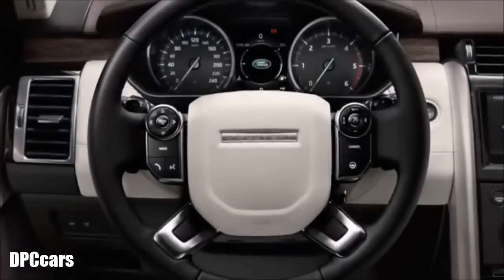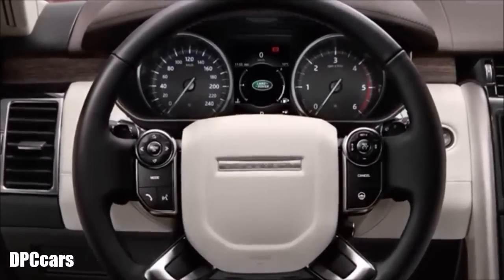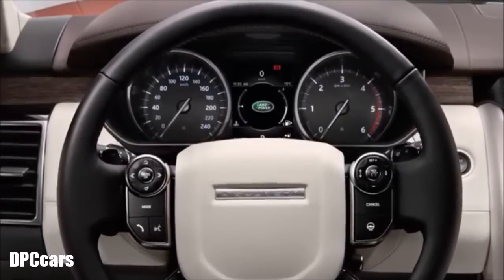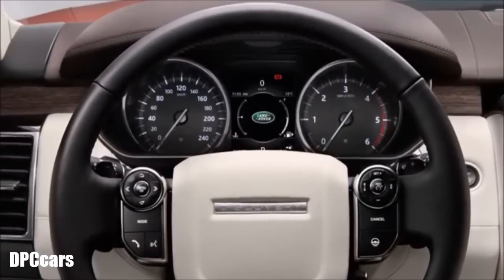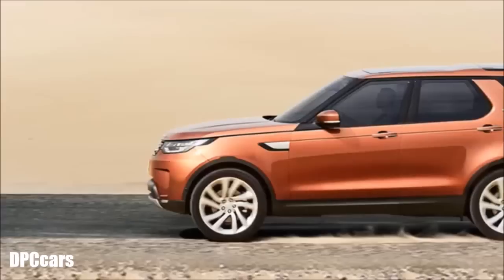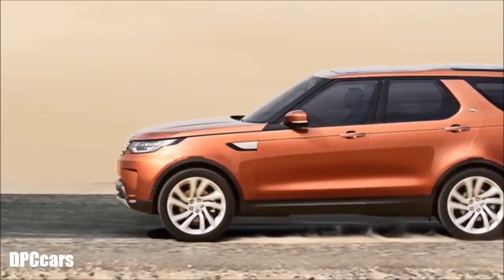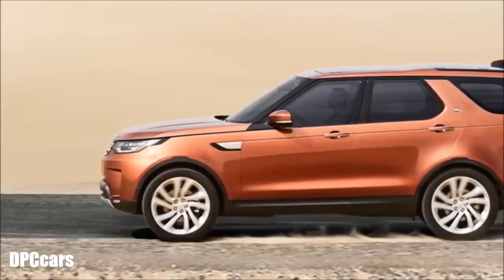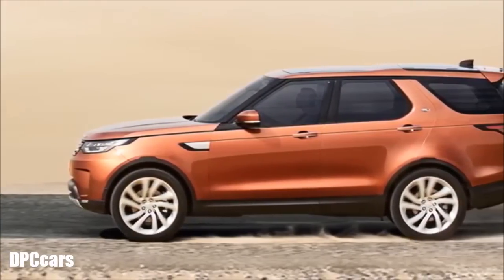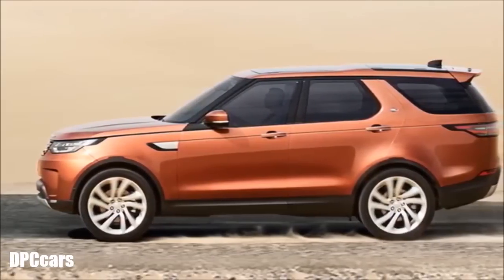This video will show you the basics of the diesel exhaust fluid DEF system, including how to top up the DEF system. In order to meet ever more stringent emissions regulation, your vehicle is fitted with a new generation of catalytic converters and selective catalyst reduction, or SCR, technology. SCR technology requires the introduction of an additive into the diesel exhaust system. This additive is known as diesel exhaust fluid, or DEF.